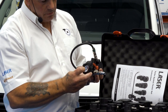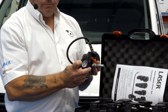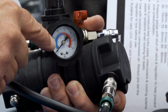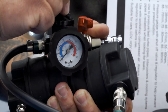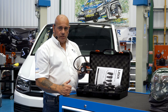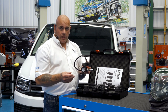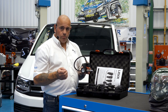Watching the gauge to see if the system holds a steady pressure — if we had a falling pressure, we would have a leak. We can gradually increase the pressure and listen to diagnose where the air leak is coming from within the turbo system. It's an effective way of quickly diagnosing a fractured intercooler or boost pipe within the system.